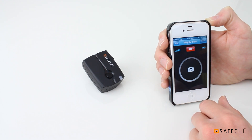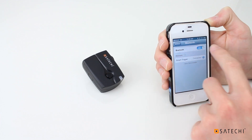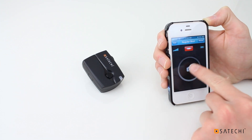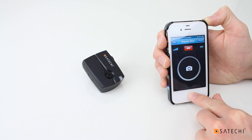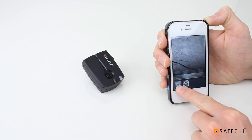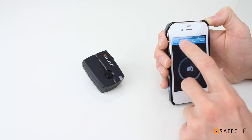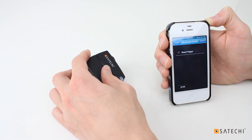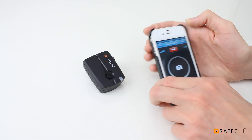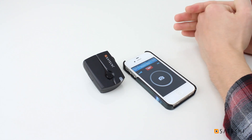I'll do the workaround process one more time just so you can see how simple it is. To reproduce the error, let's again turn Bluetooth off and on. If I go back into the smart trigger app, you can see that it's not working. So all I have to do to repair the receiver to the phone is touch the home screen, double click home, press and hold the smart trigger in the system tray, press that red minus button to quit the app, reopen the app, go to the scan menu, and then touch the button on top. You'll see the progress wheel, and all you have to do is touch it and you're back to 100%. We really apologize for any inconveniences this may have caused. We hope this video helped you alleviate the problem and we really appreciate your patience while we get that app update out.